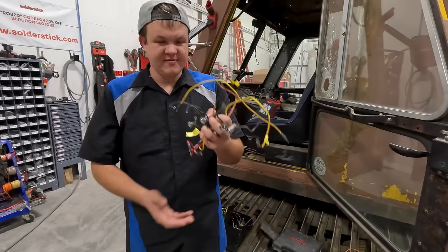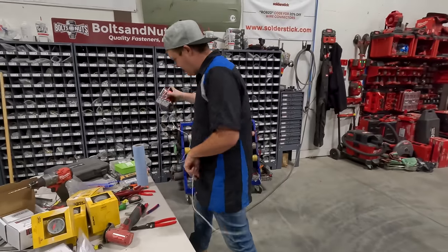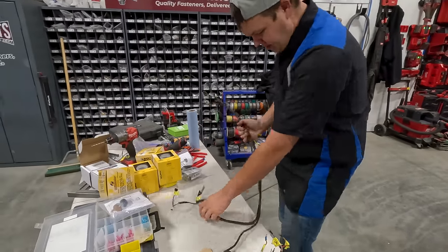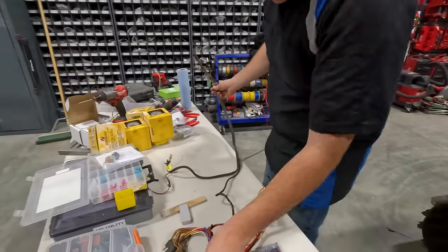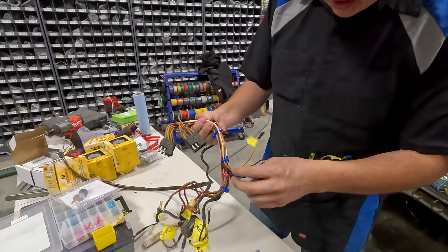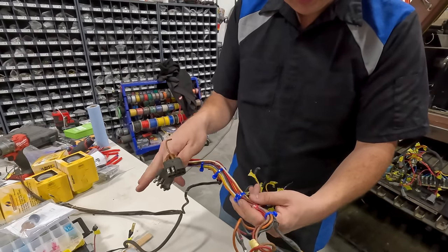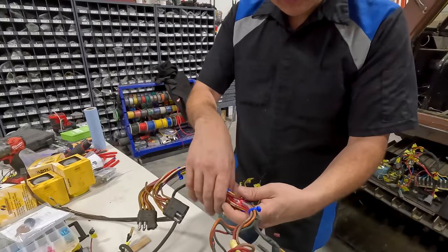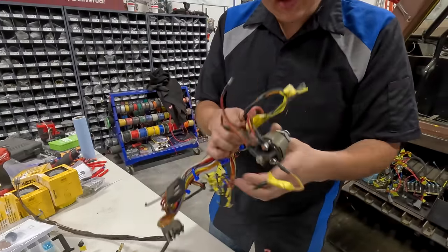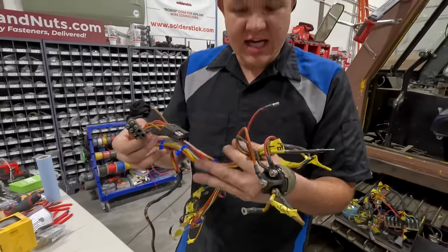Look at that rat's nest — this is the harness I have next to build. I've got it all untaped with zip ties so it won't go anywhere. This is how it was built into the harness. So I'm going to do two plugs. Various wires were all taped off — and you've got your little rat's nest to your ignition. One by one, I'm going to dissect the wires and build a new harness.